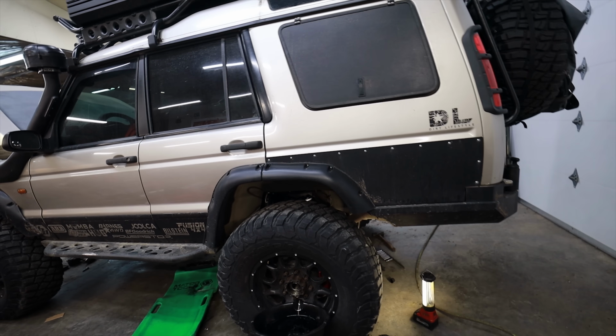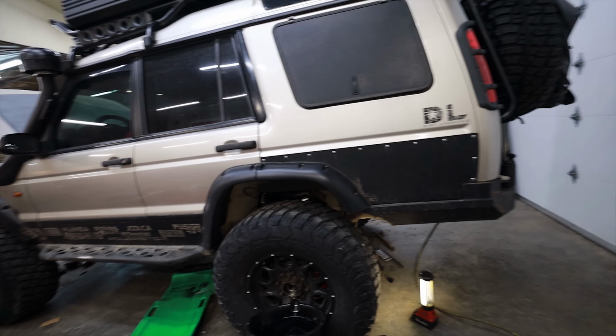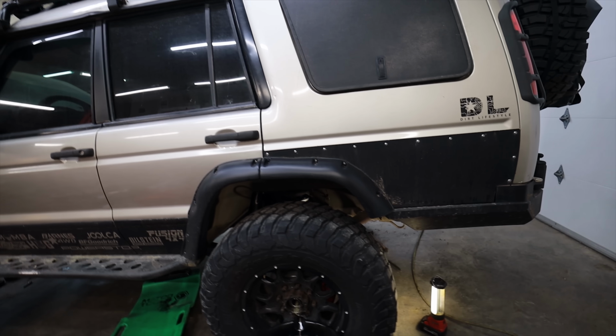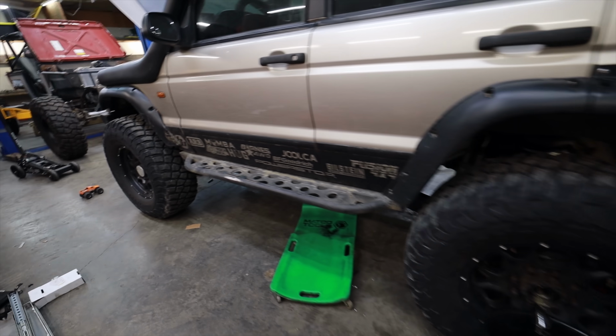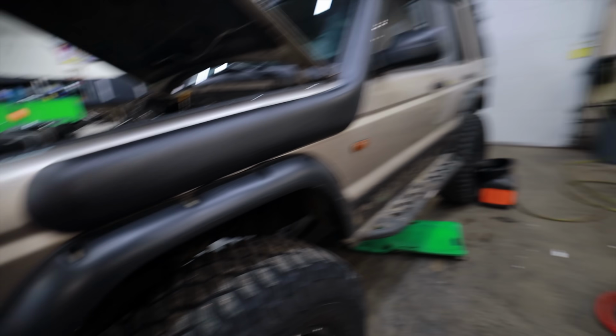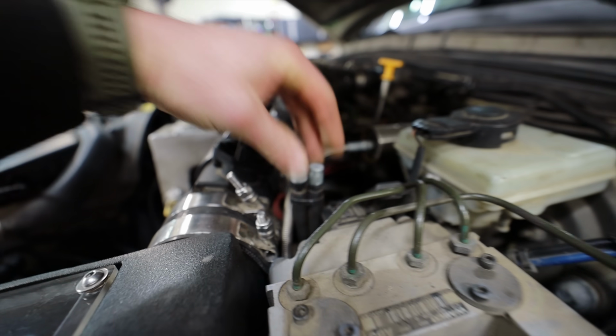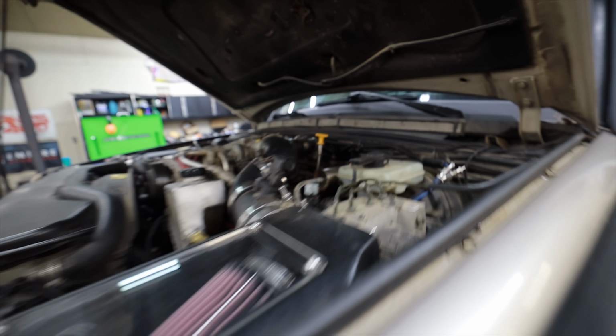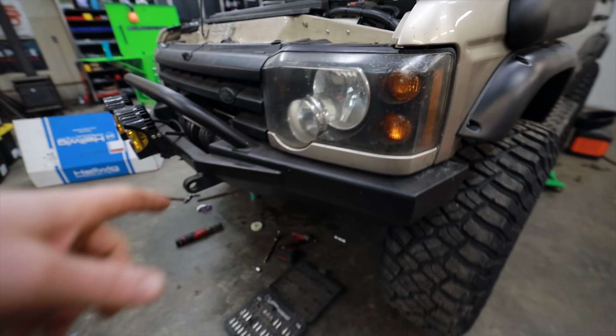the 1-ton swap. I've changed the rear oil like 3 or 4 times. Every single time it's a milkshake. So there's water getting in very, very easily, because some of those trips I didn't even go in water. It was just driving in the rain on the highway. So I want to start by saying we've got vents that are remotely mounted under the hood, and there's no way that water's like coming into the hood so much and then going underneath these vents. That's not a thing.